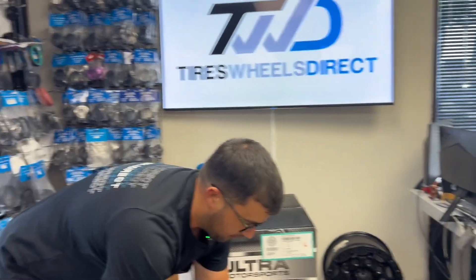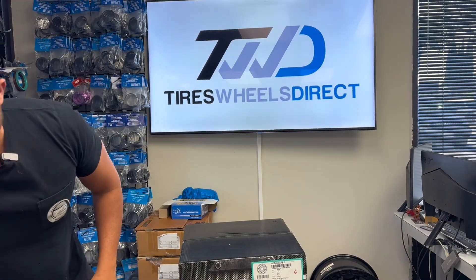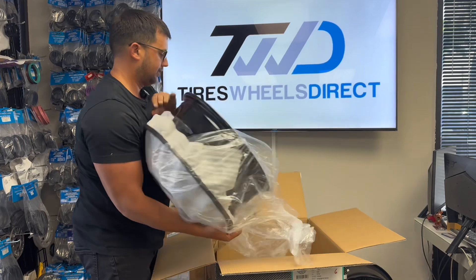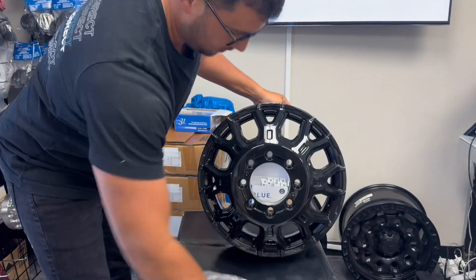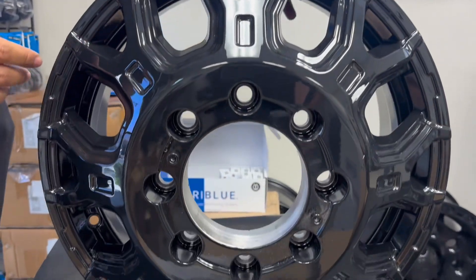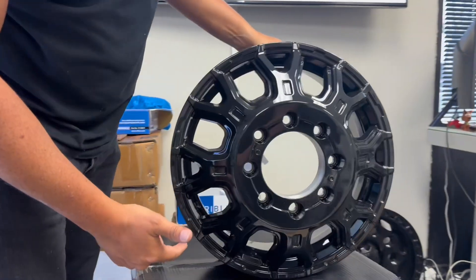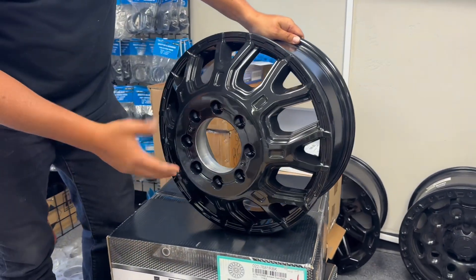So this is the rear dually. I'll pop open the front so you guys can see the front. I'm going to lay this down right here, and I'll weigh it at the end so you guys have the wheel weight. Let me pop open the front and take this out of the box. This is your front dually wheel. Your front is more of a protruded — convex is what they call it in the front, and concave on the rear. Gloss black, conical seat lug nut to go right in. TPMS sensor is compatible. The center bore is 121, so it'll fit just over these dually trucks.